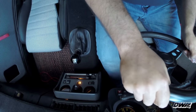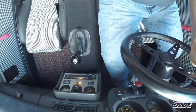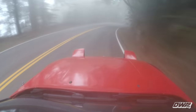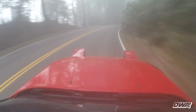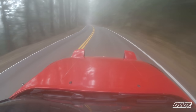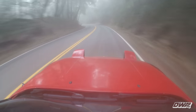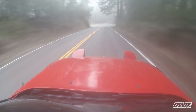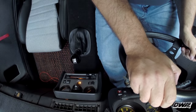As far as maintenance, I did a bunch of preventive maintenance, all the expensive stuff for the 944s. I did the timing belt, water pump, all the seals, cam belt, and got it where there are no leaks of any kind. It's all perfect. When they were in there, we also did the alternator, so it was having some charging issues. And one thing, knock on wood, the 944 has never left me stranded yet. So in 2 years of ownership, never left me stranded. But I've been keeping up on all the routine maintenance.